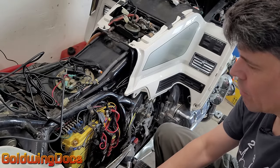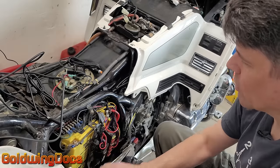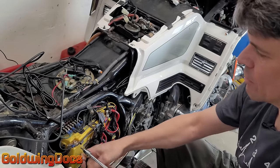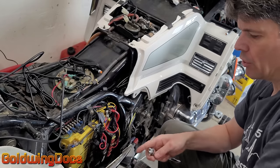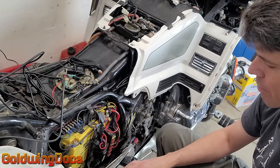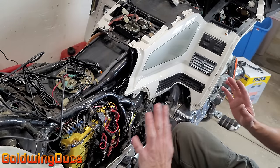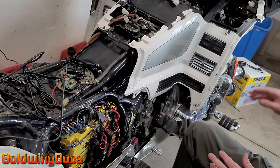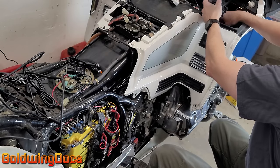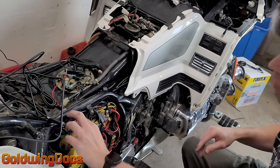So I have the camera power, battery tender, and auxiliary power plate — all fused close to the battery. Any accessory connected directly to the battery should have a fuse as close to the battery as possible: if the wire chafes or shorts, you want the fuse to blow rather than the wire to melt and cause a fire. The less unprotected wire between the battery and the fuse, the safer. Now I'll reconnect the negative terminal to repower the bike. I can see the blue light on the power supply — power wiring is complete.